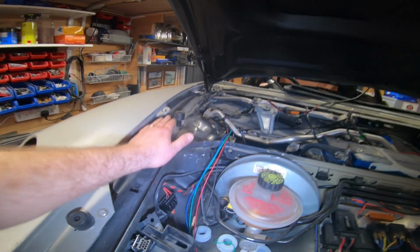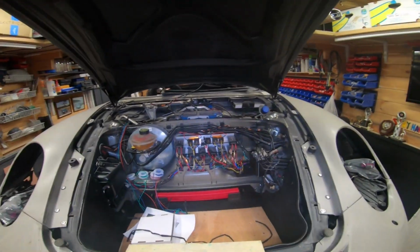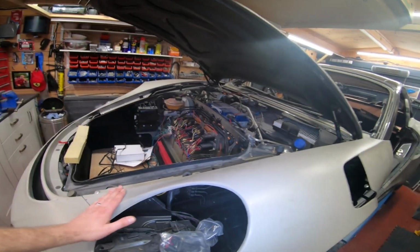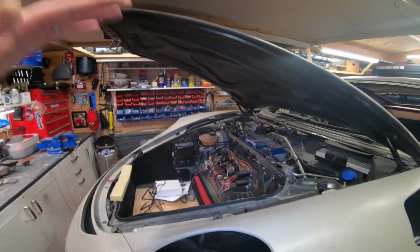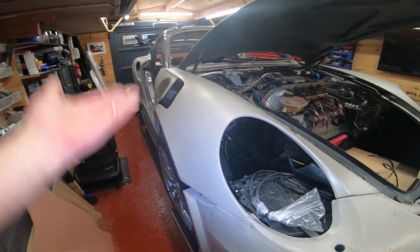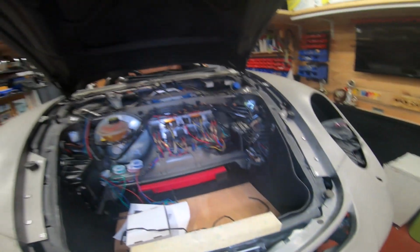And often you're going to have to play around with the spaces here to get them working right. Okay, you've got to remember, this kit was not designed on a computer. It was designed in a garage, and it's not perfect by any means, but it certainly does the job, and it's a fantastic kit. But there are going to be tolerances you need to account for. This is why when you fit this kit, you really ideally need to have your wheels, right? Because then you can make sure that the arch gaps, like this gap here, are the same both sides, or as close as you can get it.